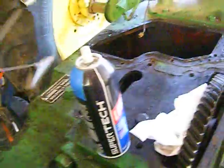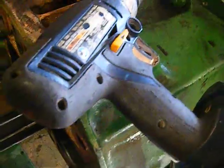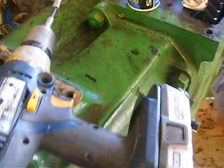What we're going to do is hone these two cylinders. First thing you want to check and make sure that your bore isn't goofed up. If it's really rusty and pitted and whatnot, you might want to consider taking the cylinder off and doing a bore, or taking the block off and having it bored. It's not grooved really bad at all. There is a little ridge there, but that's pretty normal — kind of a ring ridge kind of a thing.